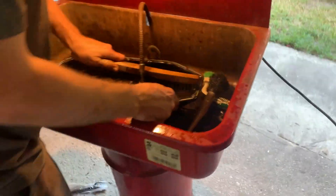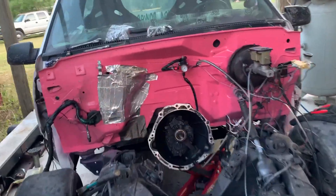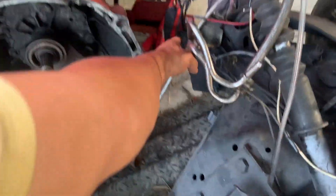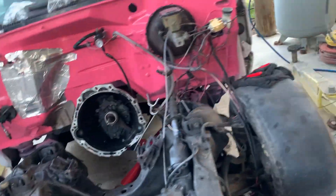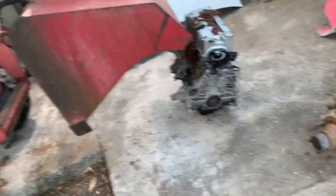We got the solvent tank back at the shop. Let's take the gasket off the oil pan - the one we got from the junkyard. They're all the same pans, K20 K24. We're waiting to put this engine in now. I'll nitpick and clean up a little bit of oil spillage and go from there. Should be almost ready to go in. We checked the injectors and it's looking like they're okay. We just pulled the engine this time so we don't have to re-bleed anything. Clutch looks fine too, not too worried. Just gotta do the water pump.